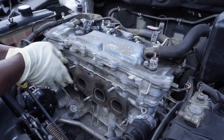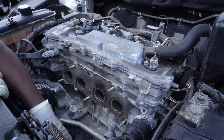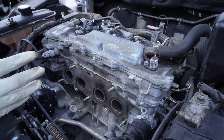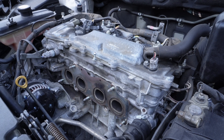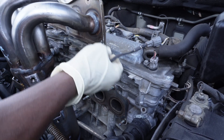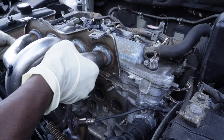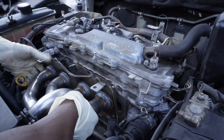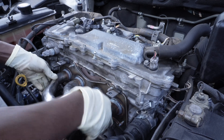I did some good cleaning. I'm reusing this metal gasket — it's a metal gasket, it's not going to leak. I reused the gasket here and the gasket at the bottom. We had a budget, so let's make this happen. I applied some anti-seize on the O2 sensor that I put in there, and on this converter I already applied some anti-seize — so let's slap this guy in. Fits.